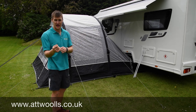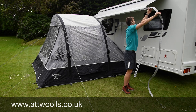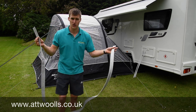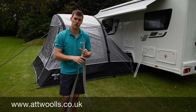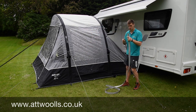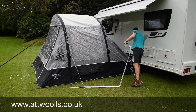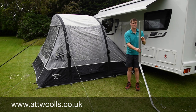What I'll do now is easily reattach the part itself. This part here is the fillet strip — it comes in different lengths; packs come in about four metres or three metres. Majority of driveway awnings just need three metres because the attachment is usually just 2.5 metres. You've got a 6-to-4 fillet strip for drive-aways and a 6-to-6 purely for C-rails. For a three-metre awning, 6-to-4 is all you really need — combined with the fixing kit, that just slides on there nicely and simply.